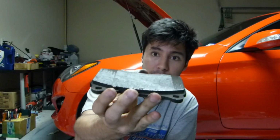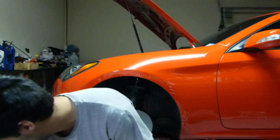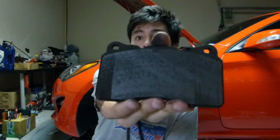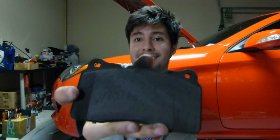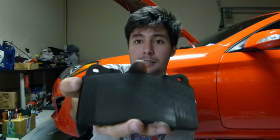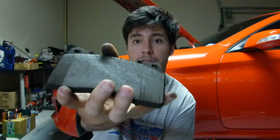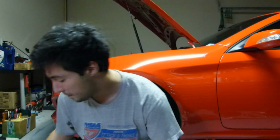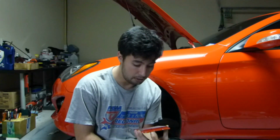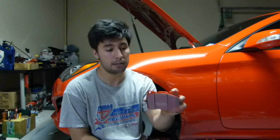The other thing was, on mine, I had nothing left. I was actually going beyond that braking pad surface and actually going out into some of those relief areas. And I think that's my worst one, where you can see on this side I had a little bit left, maybe not even a millimeter. I mean, it's almost flush with that. On this side it was just well beyond flush. It was actually wearing that down, so that's bad. But once again, the rotors weren't damaged, they were perfectly good, and now I got myself some EBC Red Stuff straight from the UK. So we'll go ahead and throw these on.